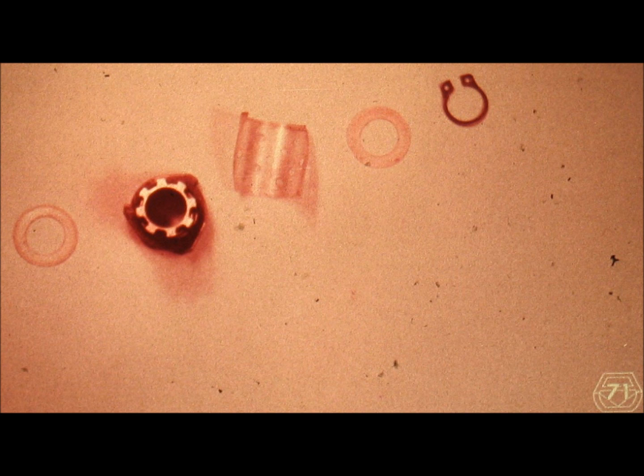It is very important that the motor be allowed to rotate independently from the motor pulley at the time when the motor is turned on. Such a condition is needed in order to allow the motor time to develop the torque needed to drive any of the typewriter mechanisms which might have been tripped while the machine was not plugged in. The motor will simply stall if the initial load is too large for it.